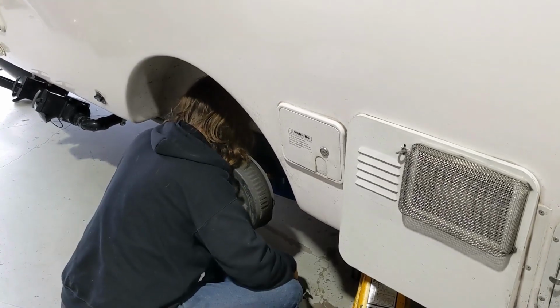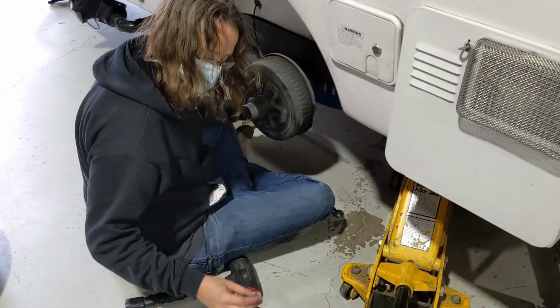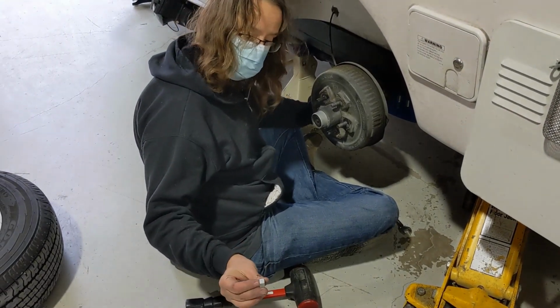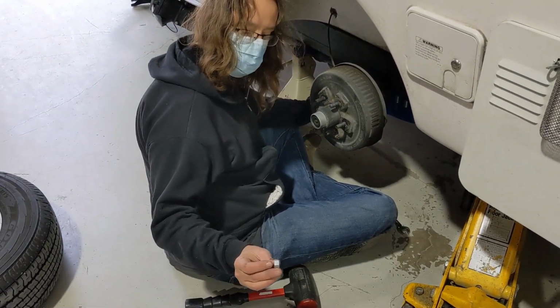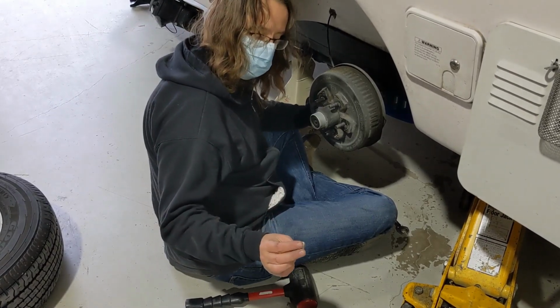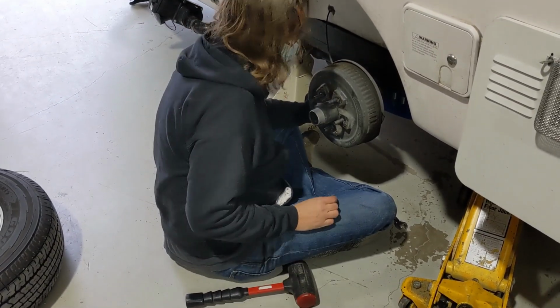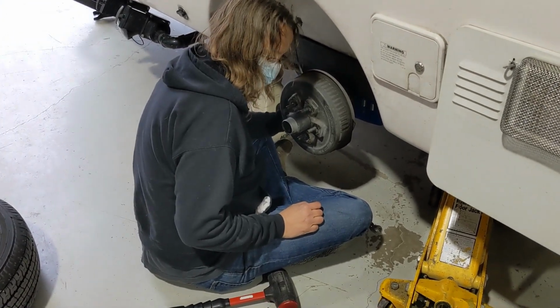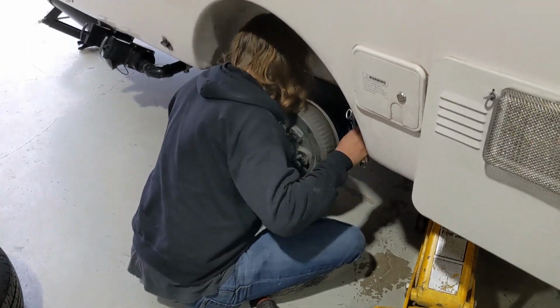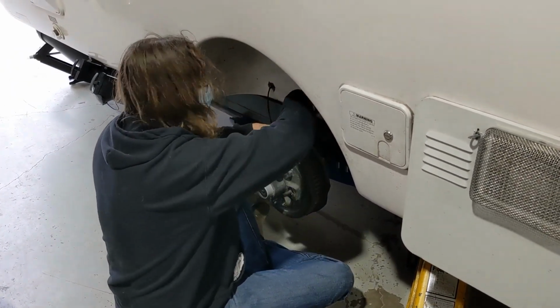In fact, what's going back on is this, which looks a lot the same, but it's not. It's actually what's known as a cinch nut. It's a lock nut with the locking in the middle of the threads, not at one end or the other. That is a 7/16 cinch nut, and it is one of the harder things to find.